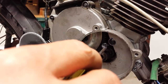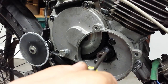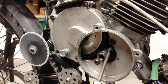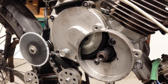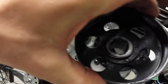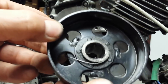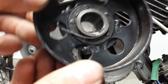Now apply a little bit of lubricant on the crankshaft extension housing sleeve. I like to use molybdenum disulphide grease — it works particularly well and stays on there for a long time. Do the same thing on the inside of the clutch bell; put a little bit of grease on there and on the sprag bearings, or one-way bearing, that allows you to pedal-start the engine. There should be five roller bearings on the inside of that housing. If you have four, you've lost one — you've got to find it; it will not work with four.